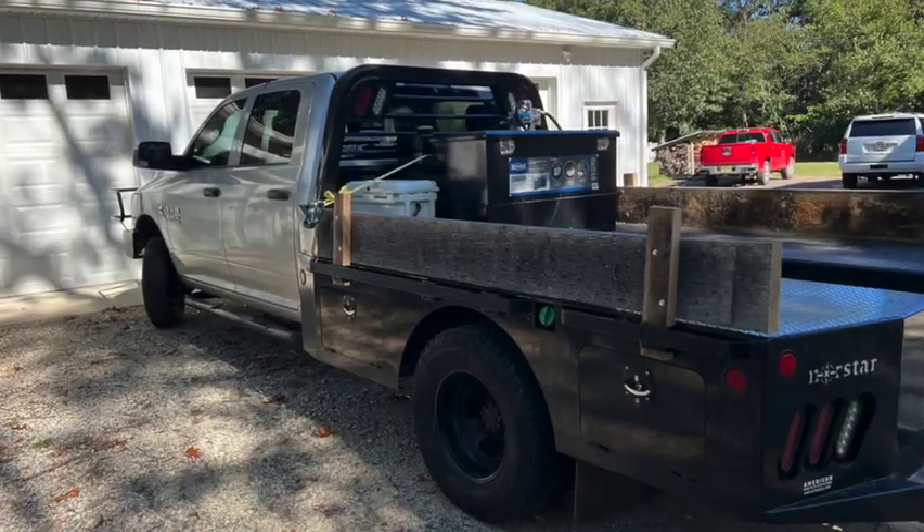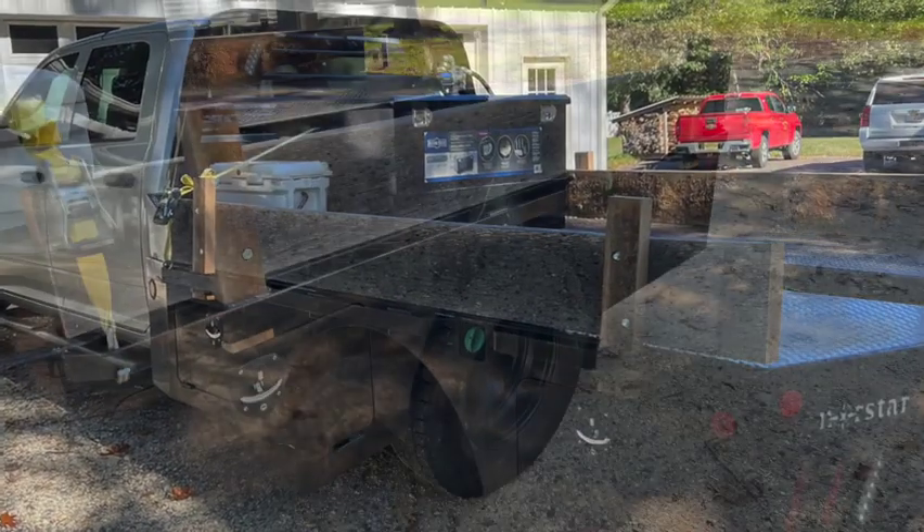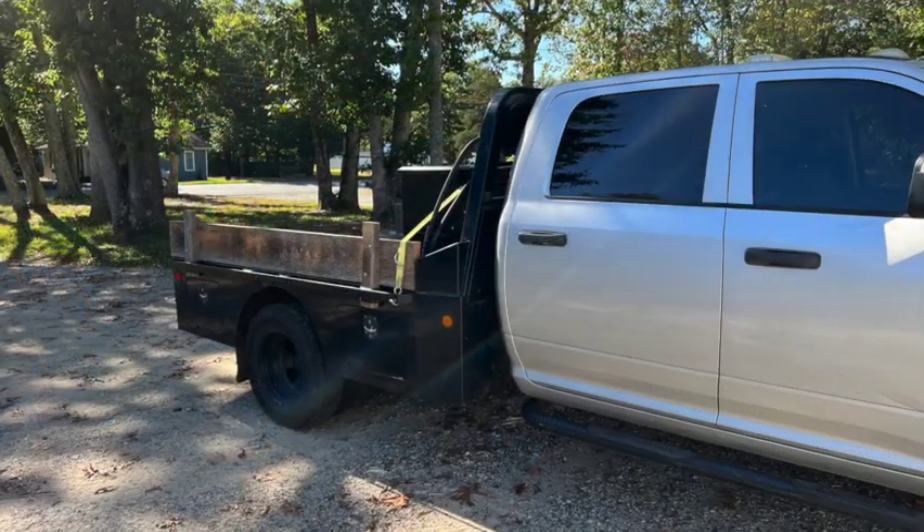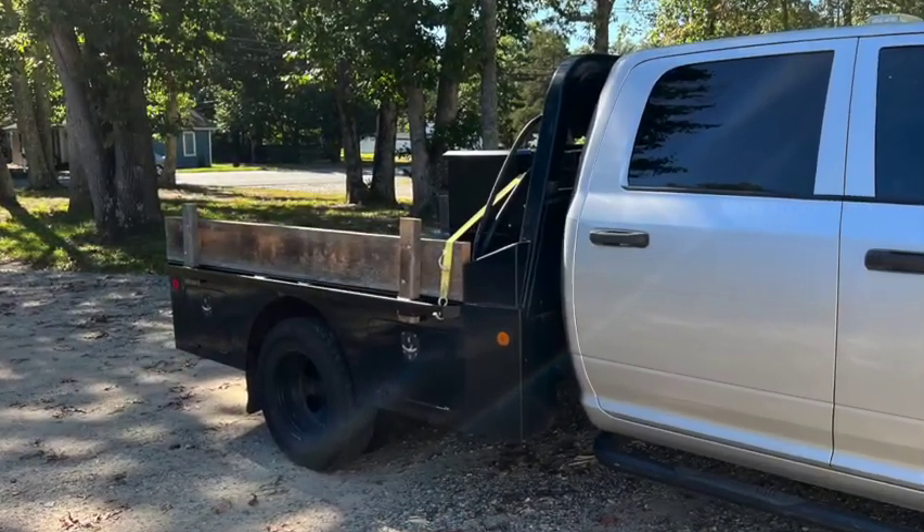Really you just repeat those steps over and over: drill your holes, pound in your carriage bolts, add the washers and nuts, tighten it up, and you're good to go. The last thing you can do as a finishing touch — which I did not do — is to cut off your stakes flush with the top of your rails. So that's a quick tutorial on how to build stake racks for your pickup truck in less than two hours. If you liked this video, please like it, share, and subscribe to my channel. Thank you very much.